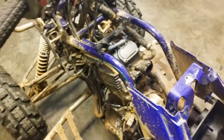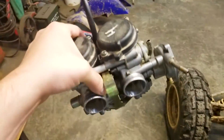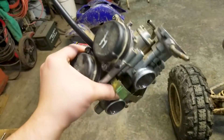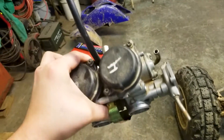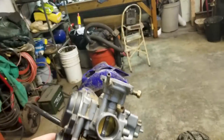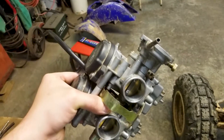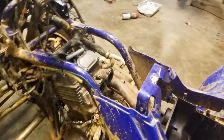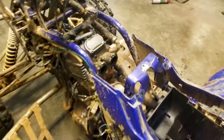That's it — that's how you get the carburetors off a Raptor 660. If you're going to do extensive work on them, wrap them in microfiber towels and put them away so you don't get any contaminants in there. If you're working on them right away, go ahead and put them on your workbench, but just make sure you don't get anything in them. Feel free to ask me anything, and if you want more videos like this please subscribe.